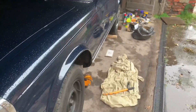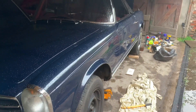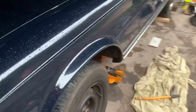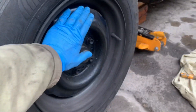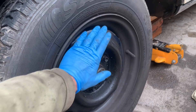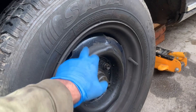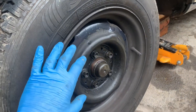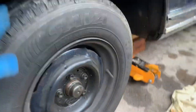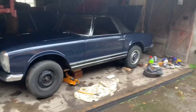It's definitely not one of those beautiful sunny days in Bristol today. We've just pulled this car out of the friend's lockup where it's been for the last eight months, and miraculously it started straight away. It's a 230SL. What's not so good is we found a whole load of dead mice in the back of it. Also, the front brake is locking on — you can smell burning when you're driving, and this wheel is hot, which is basically how you can tell.